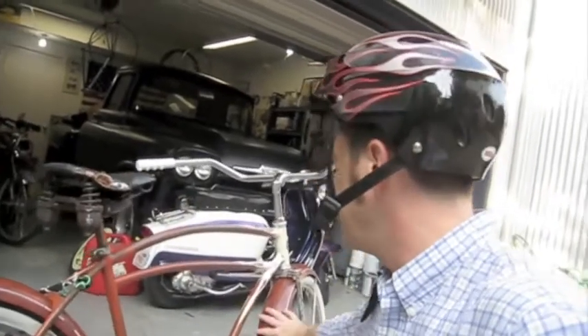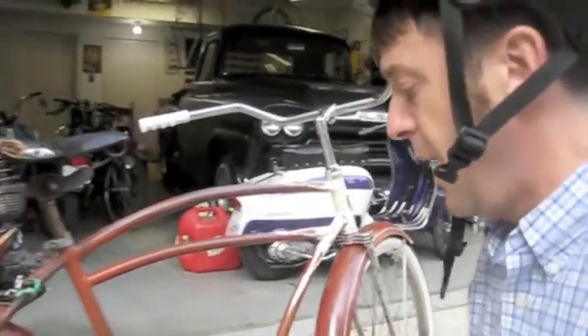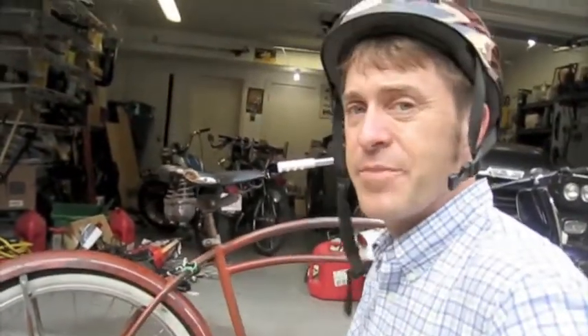To recap the Roll Fast bicycle build: I found the frame, the seat, the fenders, the chain guard, the chain wheel — the bottom bracket was still in here with the crank set — and the forks. I found all that on the side of the road on heavy trash day. What I've added that's brand new is the gooseneck, the handlebars, the grips, and the bell. I put in new races and bearings in the steering head, new cones and bearings in the front hub, a new bottom bracket, and a new crank — the old crank was bent, somebody had slammed it into a curb. I put the old pedals back on, put new bearings and rebuilt the rear coaster brake hub, put a new old-stock cog on it. Everything else was just cleaning, polishing, and straightening. Now this sucker is ready for the road.